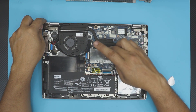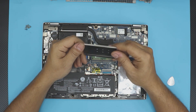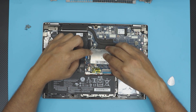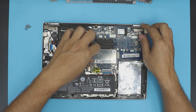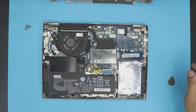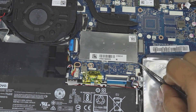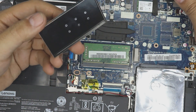Down here is your RAM. In order to remove the RAM, you have to lift up this aluminum metal cover that holds the battery. If you press on the bottom cover it should lift up. If it doesn't come out easily, grab a tweezer or similar tool, stick it on the corner, and lift it up — do that on both sides and the cover will come up.